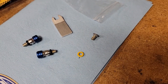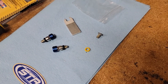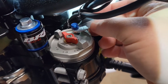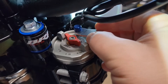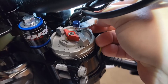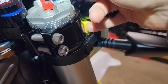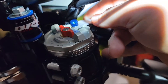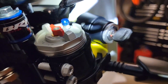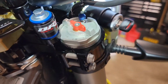I'm going to put the old o-ring back on the screw so that if I ever need to ship these forks I can pull out the bleeders and pop the originals back in. Installation is pretty easy — just start the threads by hand into the fork, then use the little wrench they provide to snug it up. There'll be a point where it just snugs up — stop there. It's an o-ring seal so it doesn't need to be crazy tight. Don't over-tighten.